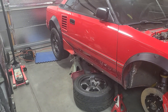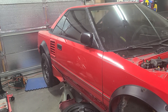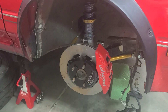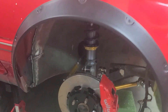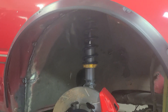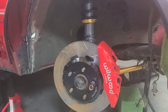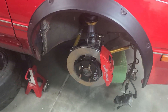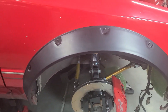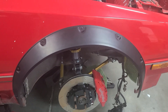Not only do I have a second-generation-style engine — technically a Gen 4 3S engine for those familiar with the platform — I've also done a 5-lug conversion, big brakes, and a fair bit of work with a custom coilover setup from Koni. The front and rear knuckles on this car are from an SW20 or second-generation MR2. I opted for these hubs because they have wheel speed sensors, which are for ABS and traction control — things I'm retrofitting onto the car.